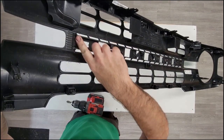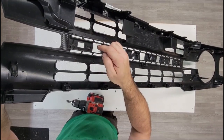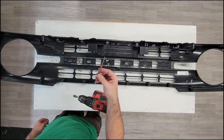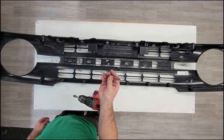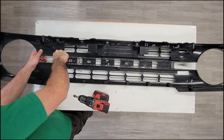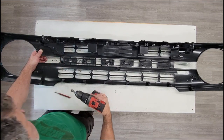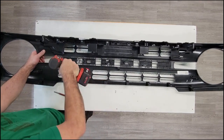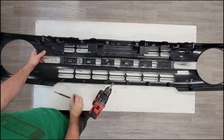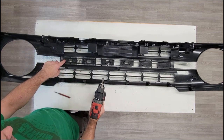Here I'm drilling down just as far as I need to in order to separate the letter from the grill. Then I'm going to use a punch — a 3/16th diameter punch, or an eighth inch will work just fine — and simply push down until it separates. If it doesn't come out easily, you haven't drilled quite deep enough. Be careful not to drill through too far, especially when using a countersink tool, because you can leave a large hole in your grill.